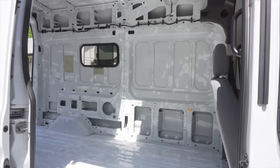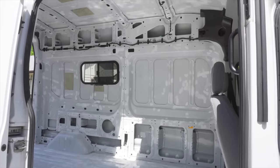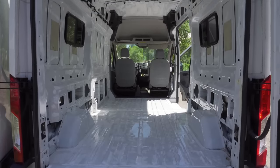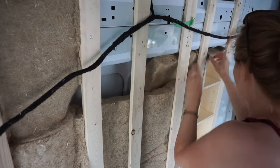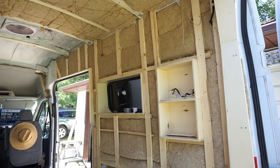There are all sorts of grooves and cavities in the body of the van and it's really hard to fill in all those areas — and you also don't necessarily want to in case you block a drain. We've considered using spray foam and that's one of the reasons we didn't use it. Insulating a van is definitely a challenge and there's pros and cons to every insulation option.